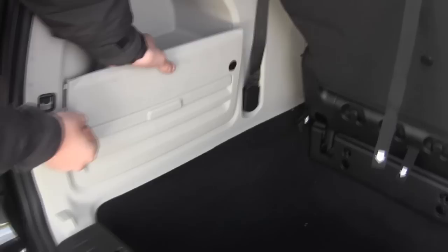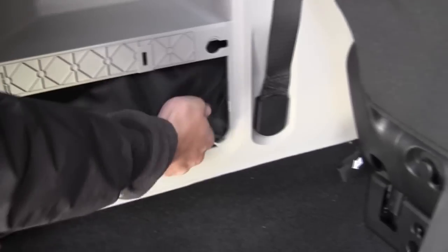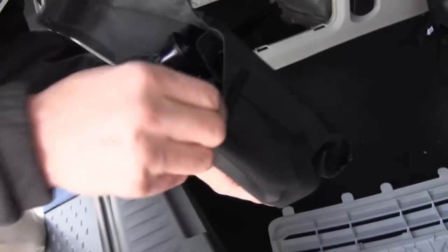You're going to go in the back — this is the first step. You're going to take this off, twist these little knobs so that they're in the unlock position and you'll be able to get this panel off. Behind the panel is going to be the jack assembly, which is going to be inside here. Also, what's going to be inside here is your lug nut wrench.